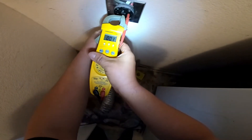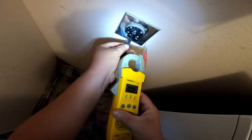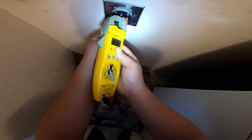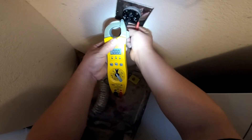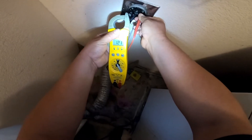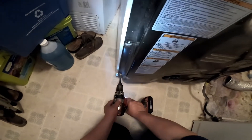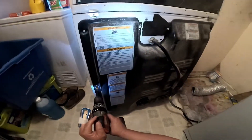The outlets on the side are for 240 volts. If you connect one on the bottom and one on the side — the one on the bottom is the neutral — it's supposed to give you 120 volts, around 120 to 122. It's giving us 121; as long as it's above 120 you should be fine. Between the two outlets on the side will be 240 volts.